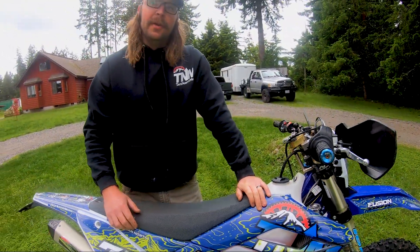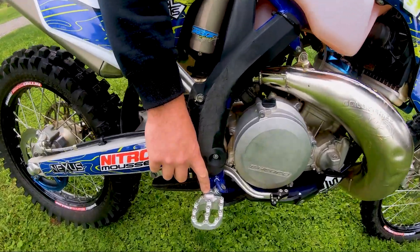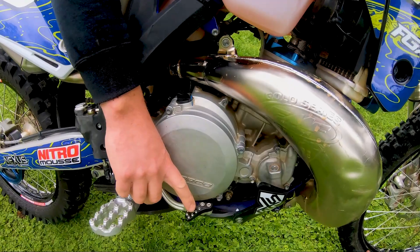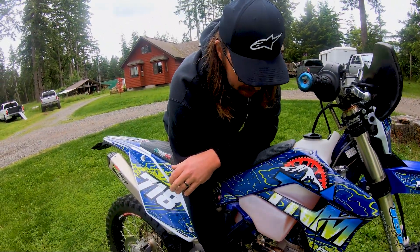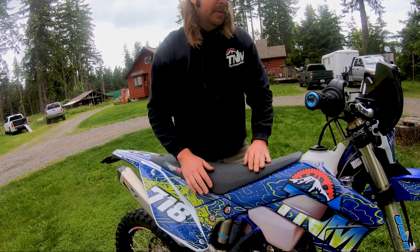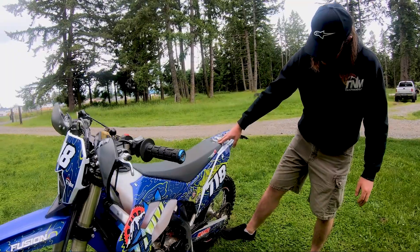The Shercos have a pretty small cockpit compared to the KTMs and Huskies, so I ended up doing some Fastway Evo Air foot pegs in the down and low position. If you're ordering these, make sure you get springs that are for the down and low position because they're different than the ones that the kit came with — the other springs would bind up and the peg would get stuck up. This is a Nēat Clean Speed brake pedal, ordered off a KTM RFS fitment and it fits the Sherco pedal. That brings your brake lever tip closer to your foot so I can stay more on the ball of my foot and still hit my rear brake. Obviously we did a full revalve, and I rejetted the carb, and I did the Bulletproof Designs swing arm tab guard in the back.